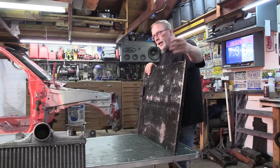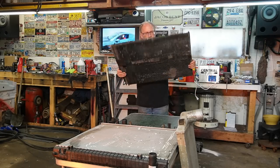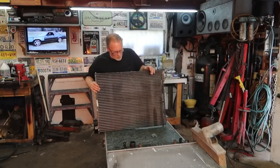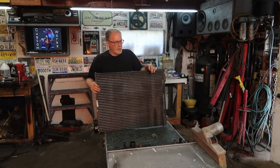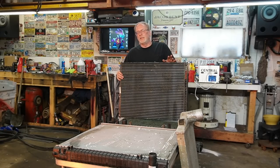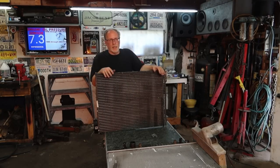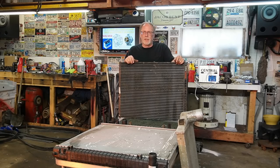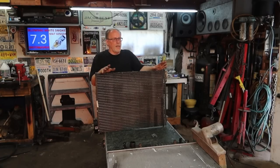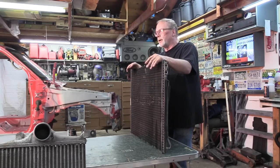All of the large debris ends up in here, and most of the time you don't notice it. But you'll see on the back side here, all of these items, you can see, have been forced through. So this is blocked up right here. You got to keep this unblocked. Down in the description will be some AC foam that I use to spray in here to help unlock all the debris and garbage that gets stuck in the air conditioning portion. And we also have a video that shows on an air-to-air how to clean from point A to point Z, again, on how to do a proper cleaning of whether it's the radiator, air-to-air, or this air conditioning unit.